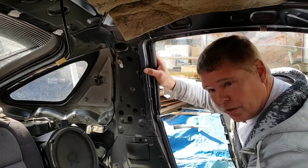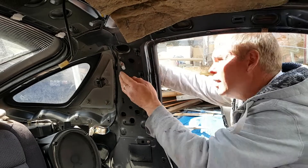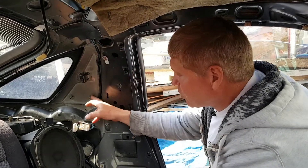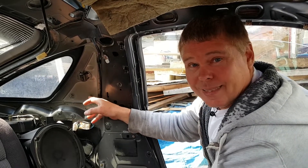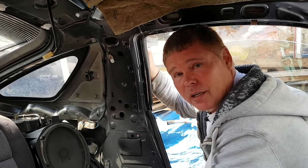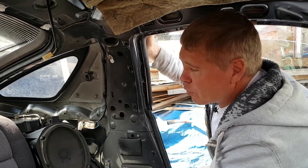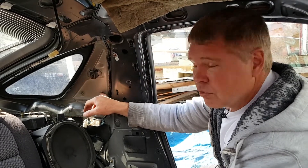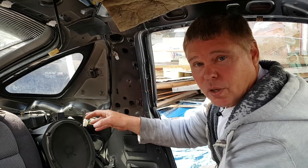In addition to this, on the other side of the sail panel there should be some rubber washers, and over time those rubber washers have become brittle and turned into a powder and fallen away. That's probably why there's now a gap here that allows these bolts to undo easily. Water will get into absolutely every tiny little crack — it runs behind the sail panel, which is quite okay, but it then reaches these little screw holes and starts pouring in through them.